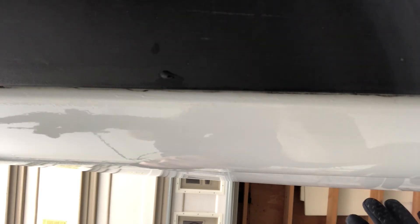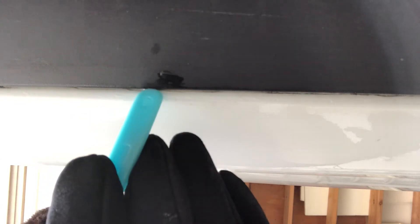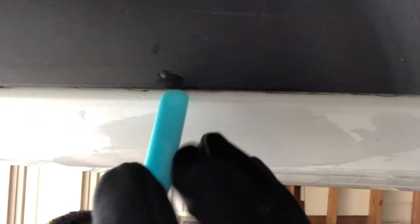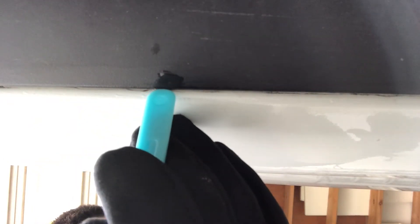One last thing about marking and installing the paint protection film: when you tape the film on the car to mark and cut it, the alignment does not have to be perfect at the bottom. If there is any extra film, you can either tuck it underneath the black plastic if the gap is big enough, or carefully take a blade and make a cut across the bottom length.